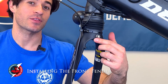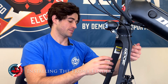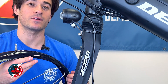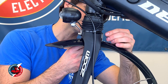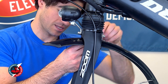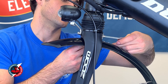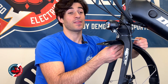Now it's time to install the fender — thankfully this fender is unbelievably easy to put in. On the back of the fork there's another nub just like the one at the front with the headlight, so simply twist it off. If you notice on the fender there's a little metal portion with a hole through it — you're going to thread both of those together, coming from the back and around, pulling it to the top. Apply a little pressure and find that hole, start spinning it in. Once it becomes really difficult with your fingers, use the five millimeter allen key, place it in, and turn clockwise until it's nicely fastened.